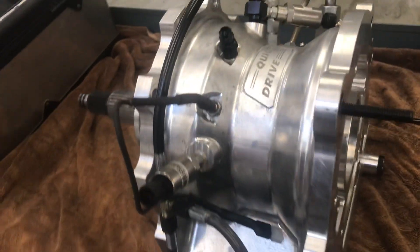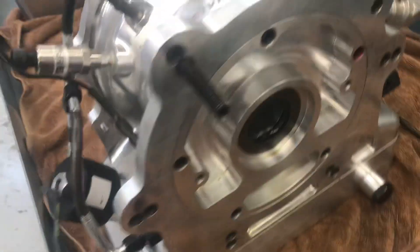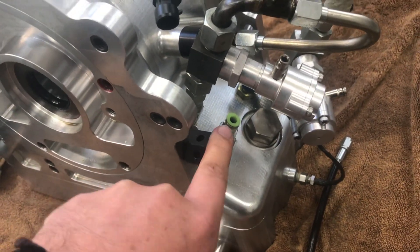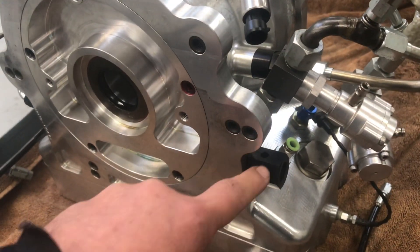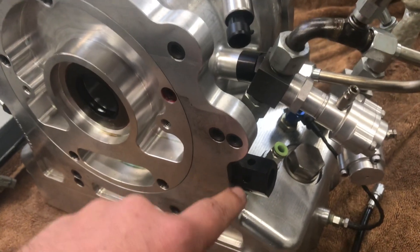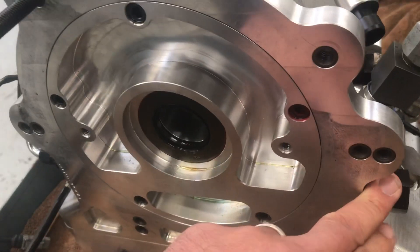There's another T-line that goes to the creep or dump valve in the car that allows the car to creep forward when you hit the creep button. The other side of this connector is wired to the other solenoid — typically a TCI valve that looks like a normal trans brake solenoid — and it blocks the other end of the channel that feeds air to the trans brake piston. When power comes off, this allows pressure to escape quickly and improves your reaction time.